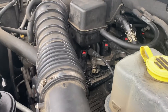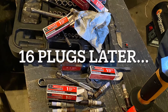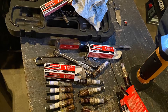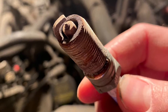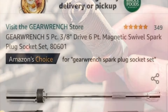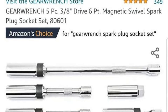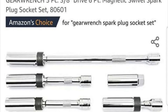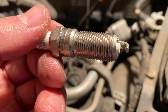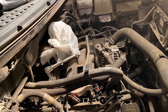I was at 120,000 miles and had never done the plugs, so I changed the spark plugs even though I was pretty sure that wasn't the problem — and it wasn't. But 16 plugs later, they needed to happen; they were in pretty rough shape and didn't come out easily. The old plugs were pretty scored. Definitely recommend using extensions and swivel magnetic socket adapters — they make getting the plugs out and new ones in a lot easier. Put a little anti-seize on them too. It took a few hours but wasn't too bad.